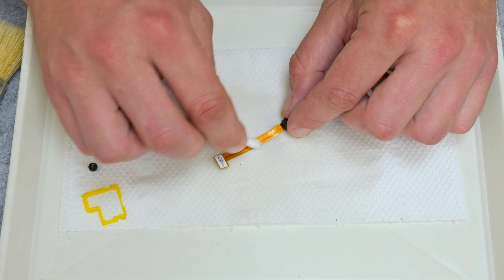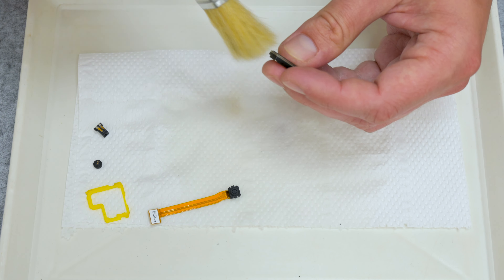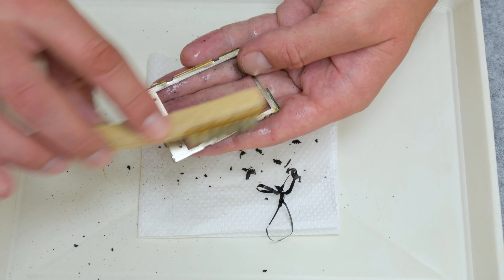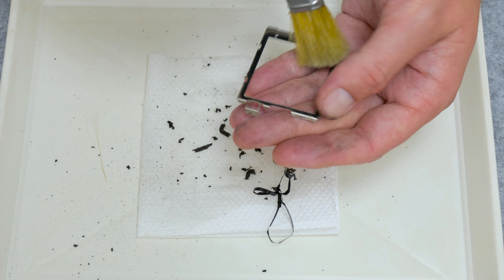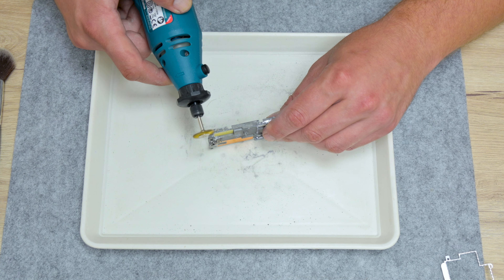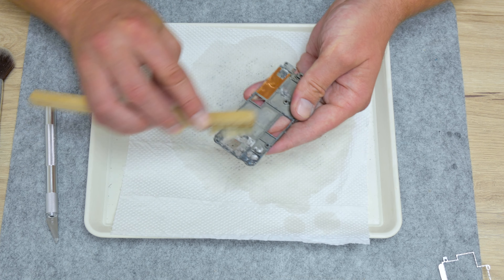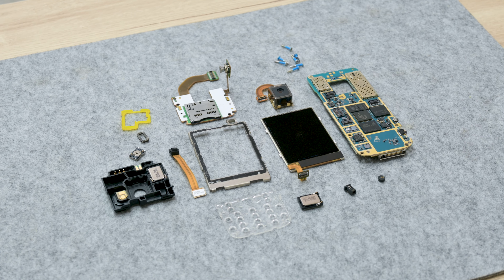The other smaller components are easier to clean, so carefully I clean every single part from all sides. The inner metal display bezel is pretty sticky — very usual after many years of use, as some glues and stickers start falling apart. The mid metal part of the phone is the most corroded. To clean this part, I used a Dremel with brushing heads, isopropyl alcohol, and after all that, I washed this part in vinegar and baking soda. Finally, all the parts are clean and ready to assemble.